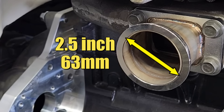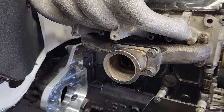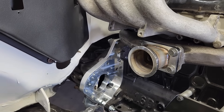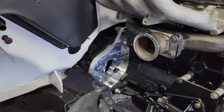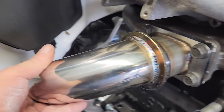The 2.5-inch exhaust is way too big, and we really need a 2-inch exhaust. The problem with going with a T3 to 2-inch adapter is the price — something like that is hella expensive for some reason. So we'll make the larger pipe work. The next part we'll need is something that'll get the exhaust pointing in kind of the right direction, and this 90-degree elbow was sourced for another $30. Now we're going in the right direction. It pays to have a plan and to shop around.